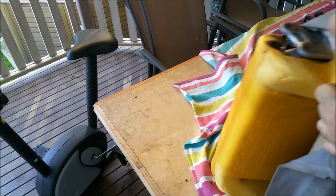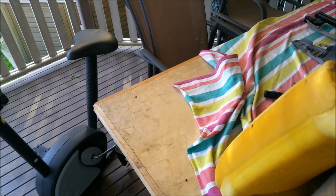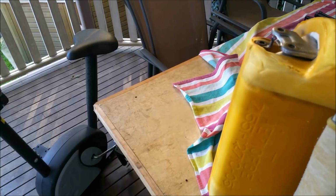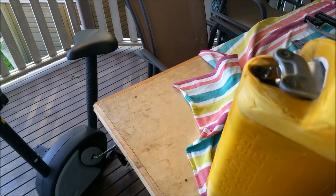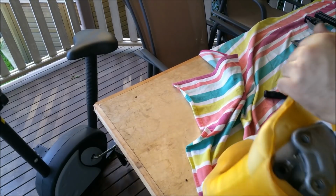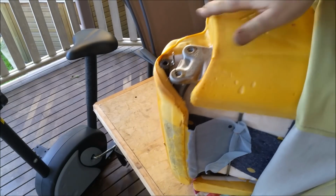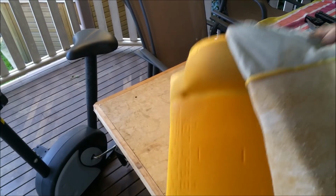Push the bolster down and start to roll it up. And you'll find most of the tension when you undo these is on the bottom part where that thick foam is. Now another thing, when you go to put these on, they can be horrendous, particularly if they're stiff at the top. One thing trimmers will do is they put Glad wrap to slide it down over, but being this is at the bottom, we shouldn't need to do that.